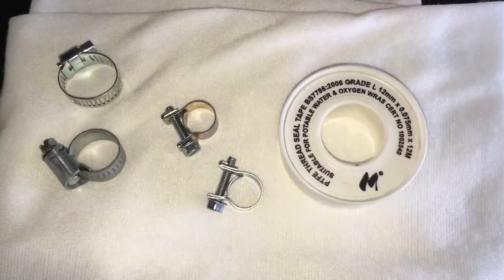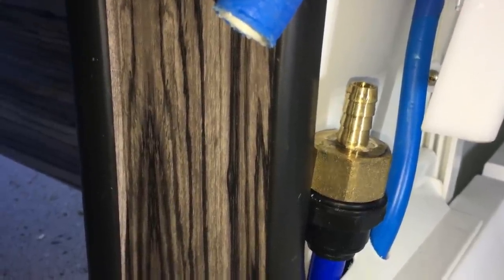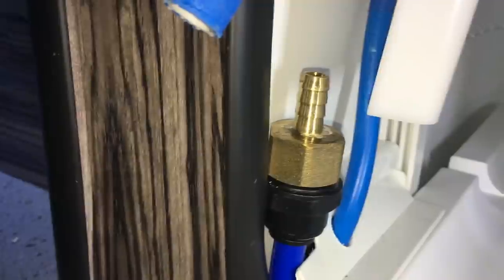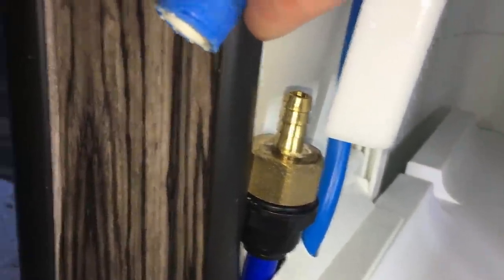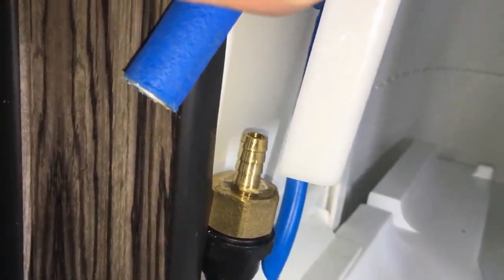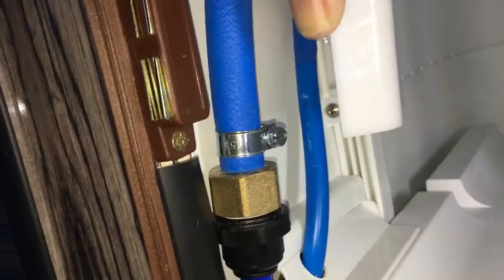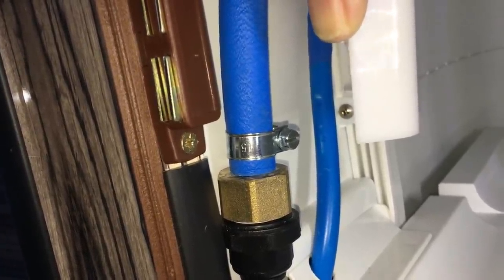It's one thing we're definitely going to have to keep an eye on because we can't have water leaking inside the van. The barbed adapter goes from a threaded connection onto that barb — that threaded connection has got a rubber washer inside and a bit of PTFE tape, so that joint is actually fine. It's just where this hose is pushed onto that barbed fitting — that seems to be where the leak is. So I'm going to wrap a bit of PTFE tape around that barbed fitting and try that fuel line clip. That joint is now remade — we've got PTFE tape around the barb and the new fuel pipe clip. That does seem to have gone on there a lot smoother, so fingers crossed. Let's pump up the water.